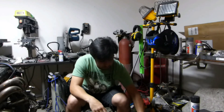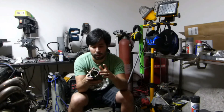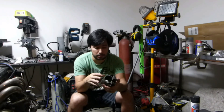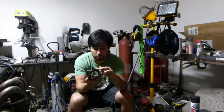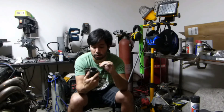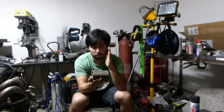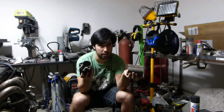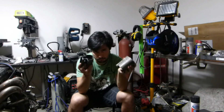So the last remaining thing: we have welded it and need to grind off some of the spatter. None of the welds are really super proud, so we won't have to grind those down much. They don't look perfect, but I'm a function person — they look about as good as MIG is going to look, minus the spatter and stop-starts. I'm going to grind it down and then chop it to the exact same length as this, so our ride height isn't changed substantially.